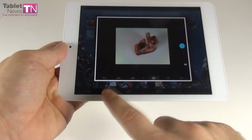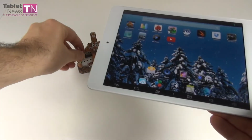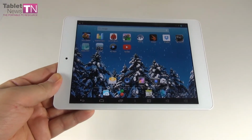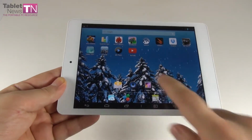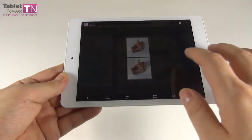You can also take some video with automatic zooming in, and you can take a panorama. And as I said, I wasn't very impressed by this camera. It's a 5 megapixel camera, in case you want to know the identity. It's got a sensor that's an OV5645. It does Full HD video, it does panorama, it takes noisy pics, and the autofocus is not as fast as one would want it.